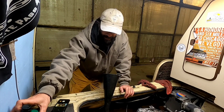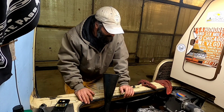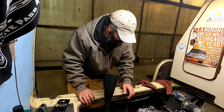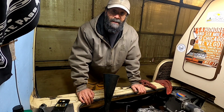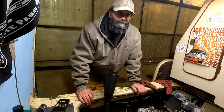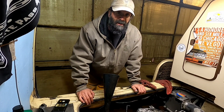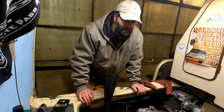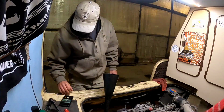funnel, just a couple of quarts of oil. Put them back in, and make sure that everything is tight and clean and dry. Put the cap back on when we're done. Start it, check it, and of course find out how much oil is in there on the dipstick. A very simple job. Manufacturers say 3,000 to 5,000 miles anymore, once every 3 months or 5 months, or you do you. Sometimes it's once a month out here.